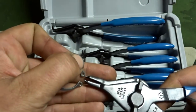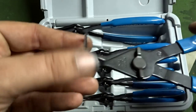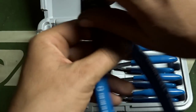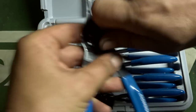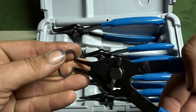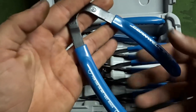These are brand new so they're currently set for a different type of snap ring. How they work is you put the two detents or tips through the holes and either squeeze, or you switch the selector by flipping the lever, lifting it up, moving it over, and locking it down. They're a little tight since they're brand new, but they will break in — they do have a break-in period. You squeeze and it opens the ring up so you can lift it off the ball joint.